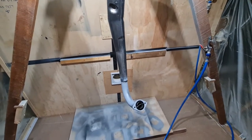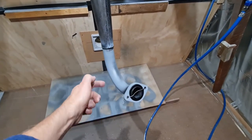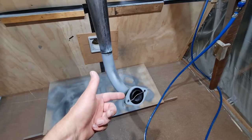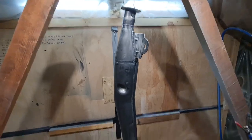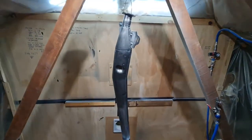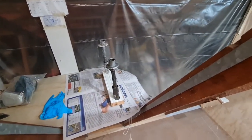Okay, let's put some paint on. I did a little bit of spray yesterday - these flanges move around so I just sprayed the ends in primer and put the top coat on, then let that dry overnight. Now I've got the flange held in place and I've hung the pipes up from the ceiling so I can spin them around as I spray - makes things a bit easier. I've given them a final wipe. I'll put primer on this one, swap over with the other one, then we'll prime the silencers too.